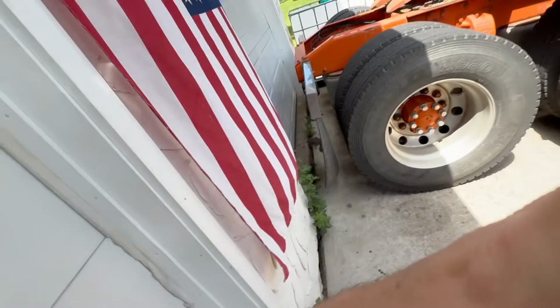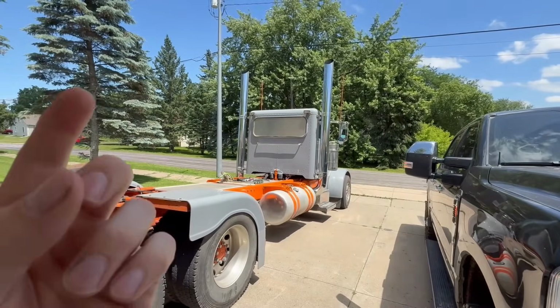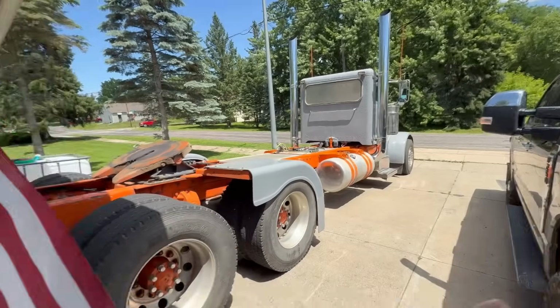We're just trying to get it ready for pulling on July 11th. That is my main goal right now. So I got other things to worry about first. We got to get drive tires for this thing yet. I got to take the truck up to Leroy. We got to run an overhead on it. We got to run an injector test on it, make sure the injectors are firing correctly. I do feel like I may have a misfire a little bit, but I can't tell.